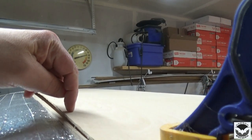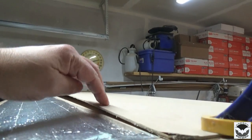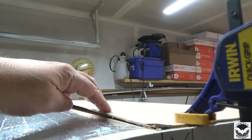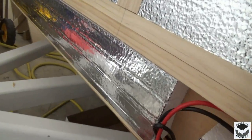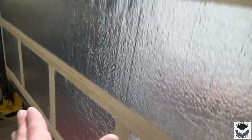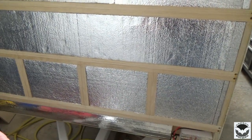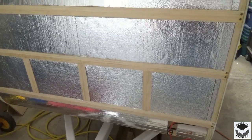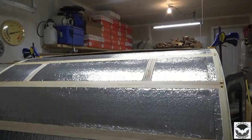So we'll have to trim that piece back 3/4 of an inch or so. And then we'll take another piece, we'll run it from there down the front and locate it on this spar just above these braces here. Then we'll be able to take our bendable plywood from the bottom, roll it up to this point here. So this front section will be a lot shorter. It won't have as many waves, and it'll look a lot better than if I use that 1/8-inch bendable plywood,